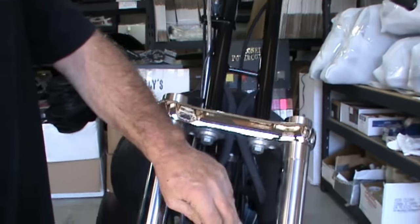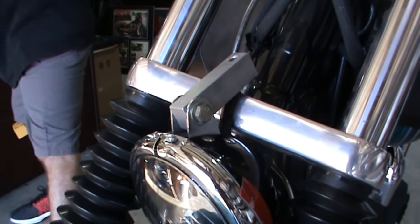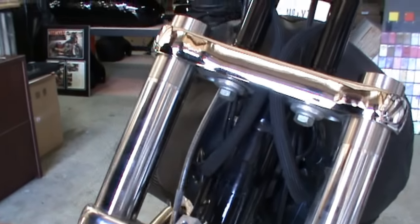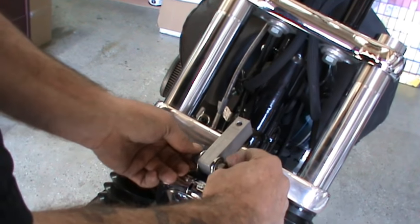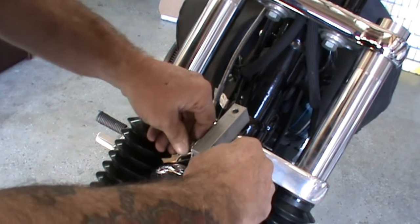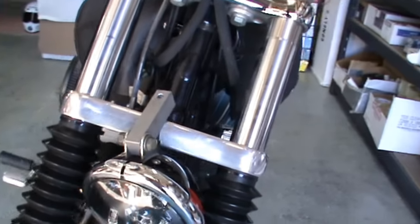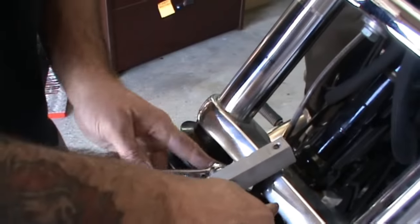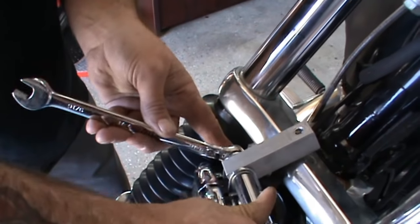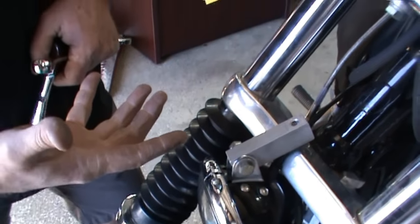Headlight block — you're going to install this on the bike prior to mounting the fairing. This is where you would require the 9/16ths ratchet and socket, along with the 9/16ths wrench. At this point, I'm not tightening the headlight up completely — I'm going to snug it up, but allow the headlight to move. The reason is so when I'm lining up the headlight where I want it in the fairing, I can move the headlight where I want to move it.